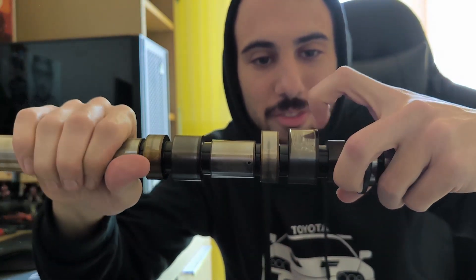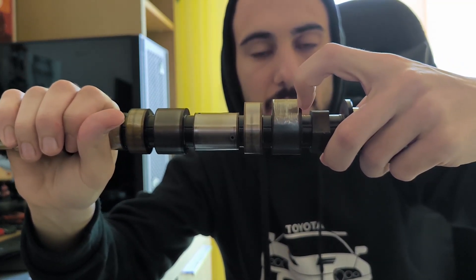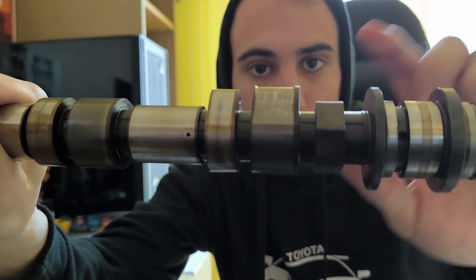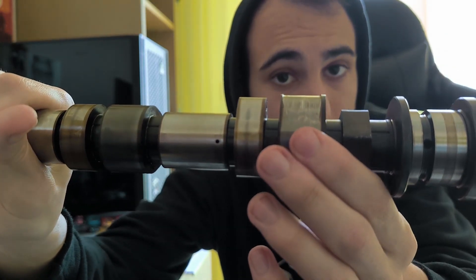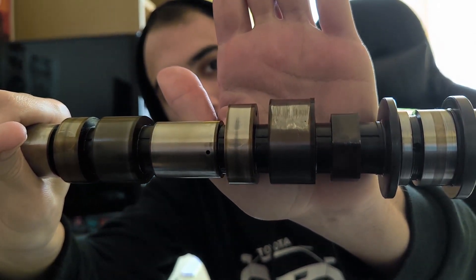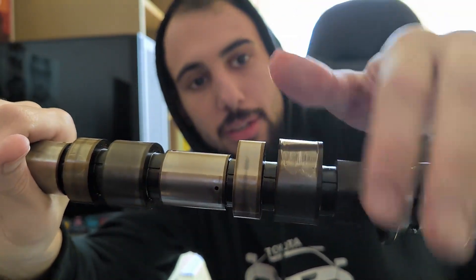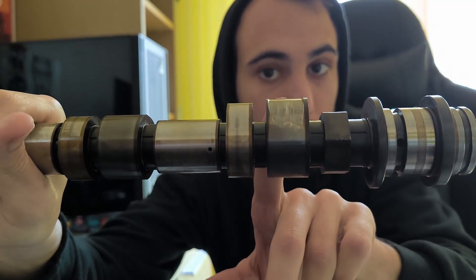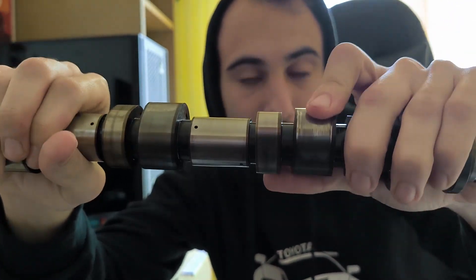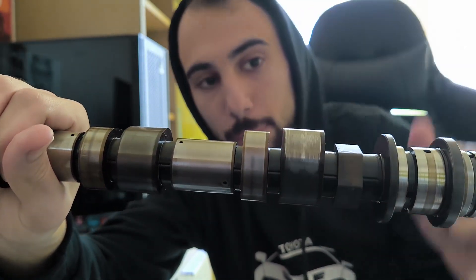My 1st one is completely trashed — it catches the nail clearly. You can pause the video if the camera is focusing. You can see a grey line on the two edges and then how much deeper the actual camshaft surface is. This is the part that pushes down the rocker arm — not the two edges — that's why you can see it getting wiped there.